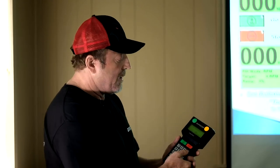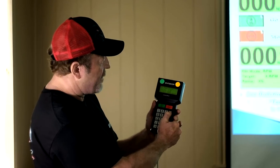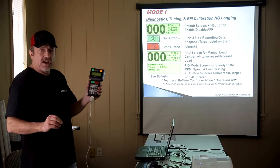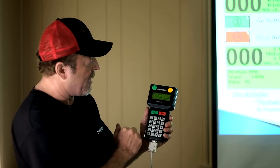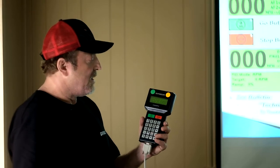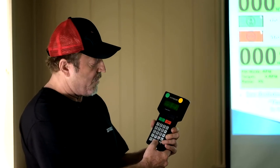There is one reason you may need the setup button: in firmware version 6.7 and higher, there's a screen called VRS PID ON. By default it's enabled, and I recommend it always be enabled. If it's disabled, the controller looks at a lookup table in firmware rather than the load cell. Some units have shipped with this disabled by default, so check that setting near the last screens under the setup button on the handheld.